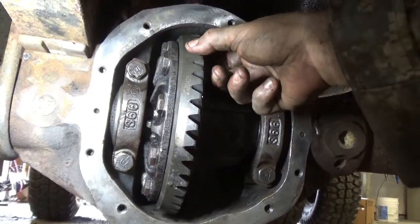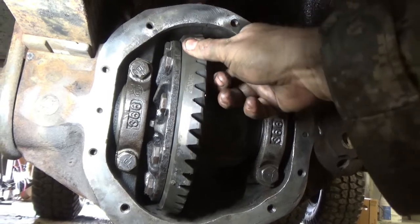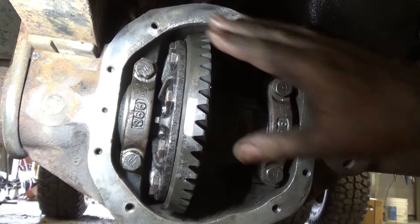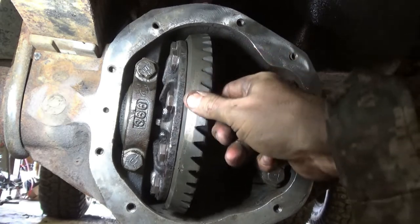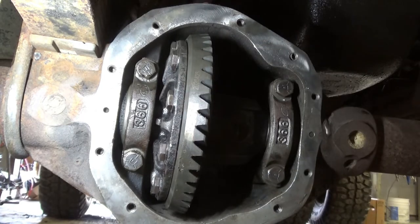So if you're wondering, that's way too much. Like, I don't even need to measure it. I probably will just for a baseline. But I'm going to say we need to throw like 20 thou at it. Flip 20 thou from this side to this side. So the good news is thanks to our setup bearings, that shouldn't be a big deal.